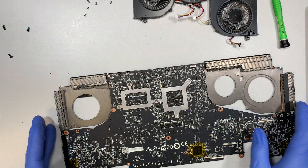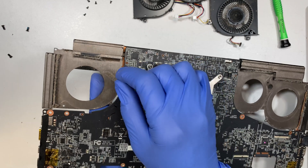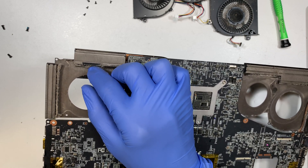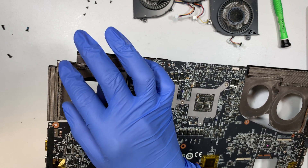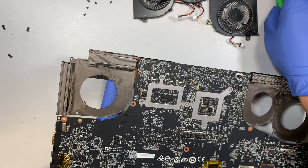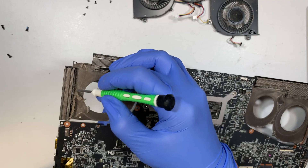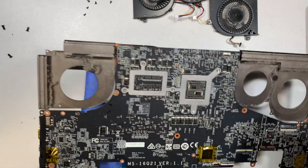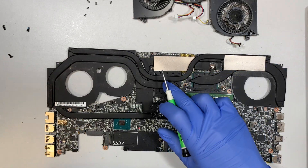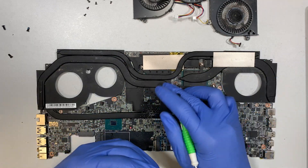That's how you remove it. You can check all this dust — over time it builds up. All this dust and lint is what makes the ventilation suffocate and causes the computer to overheat. When it gets too hot you get performance decrease, and you can prematurely kill the CPU and graphics card. If the computer is running really hot, clean off all this dust. If the heat sink is still very hot, unscrew everything, remove the heat sink, and apply new thermal paste.